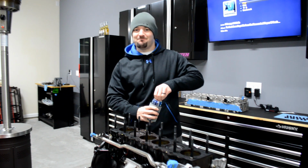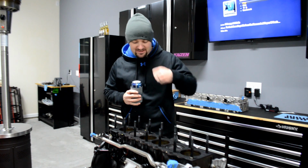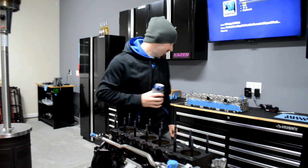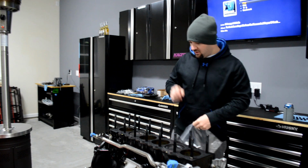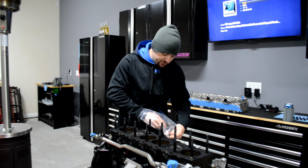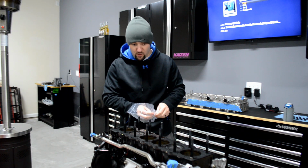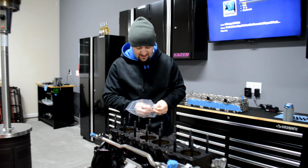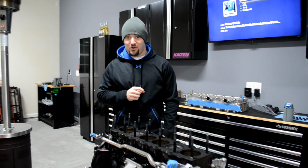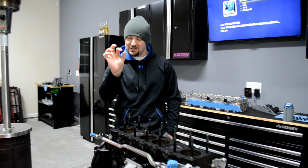In the last video, you saw that there was a head on it, and it was cranked down, and it was done. My dumbass, where's it at? When you put the head on, you have the head studs. Well, there's another item that you need. There's two dowels that go around the one front stud and the one rear stud. My dumbass forgot to put them on. So after all that work, I had to take the head completely back off to put this little piece on.